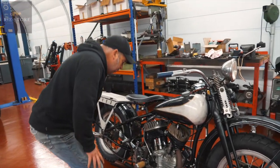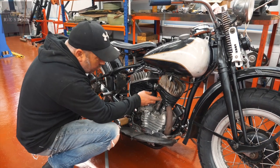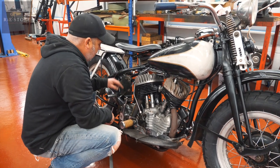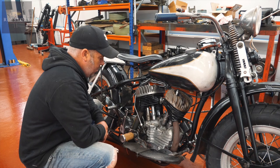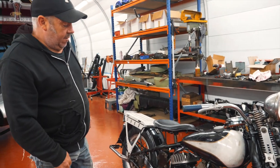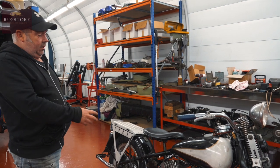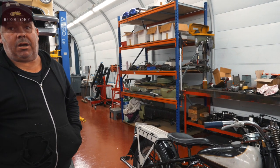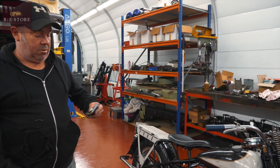All I've got to do is run that wire through there, up along here, through the frame, down with that lot and tuck it in. The other wire just goes to earth, that's it. It's possibly a bit of a pain when you want to stop it, but it's hidden and out of the way. If Craig doesn't like it, it's very easy to unwire. That is how you switch the bike off — the only way is by earthing it out, unless you put it in first gear, foot on all the brakes, pop the clutch and stall it, but that's not a good idea.